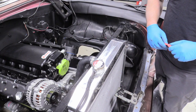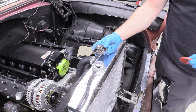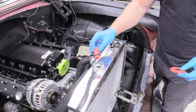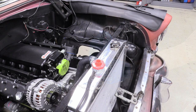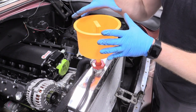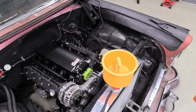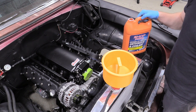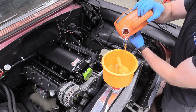Now it's a pretty exciting part — and I'm not going to lie, I'm a little nervous; everyone should be at this point. Remove our radiator cap, make sure your cap looks great, and then I have a fancy funnel. You could just use a regular funnel, but I have this nice one and since it's just me here I want to keep an eye on everything. What makes this fancy funnel cool — link down below — is it has a plunger: you put the funnel on, put the plunger in, pour a bunch of coolant in, pull the plunger out, and then get underneath the vehicle to see whether or not you have any leaks. I have some pre-diluted 50/50 mixed antifreeze and coolant — alternatively you could use distilled water and concentrate — and I'm going to pour that into my fancy funnel.